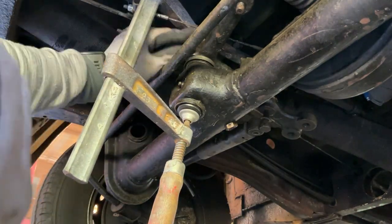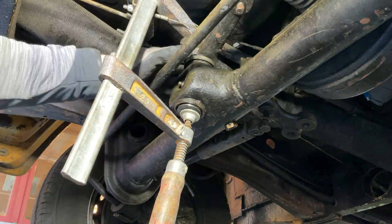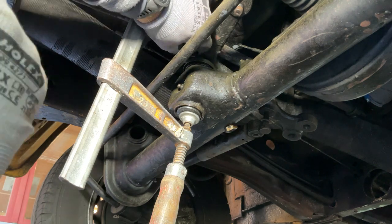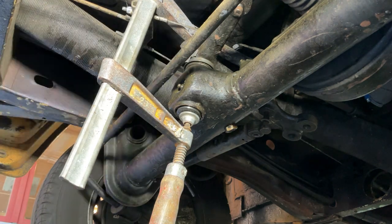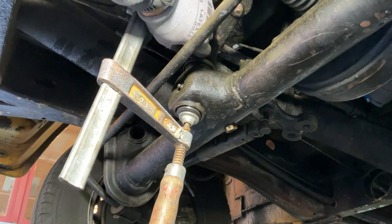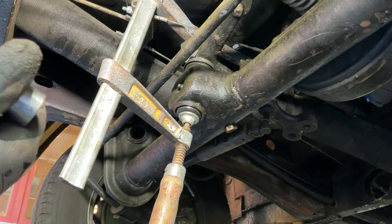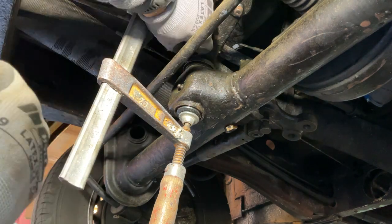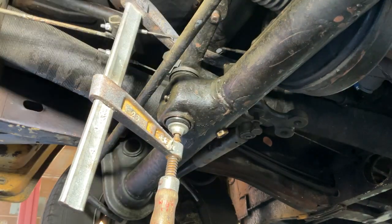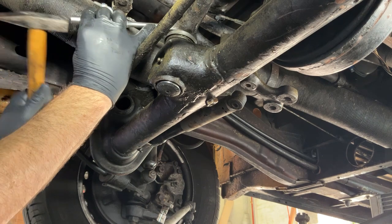Reassembling the system is quite well explained in the maintenance manual. You see that on a nice picture. It is crucial to take the right torques for the bolts and the nuts, and also to secure the bolt and the nuts with cotter pins, or as you can see here, with a piece of sheet metal that keeps the bolt always in place.